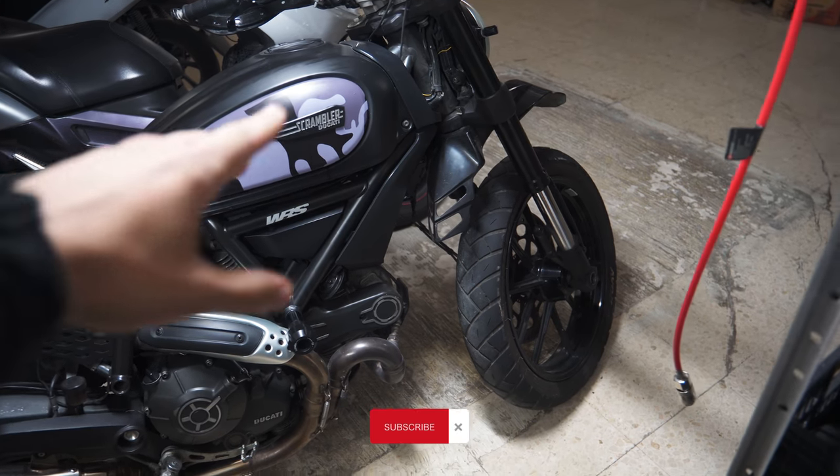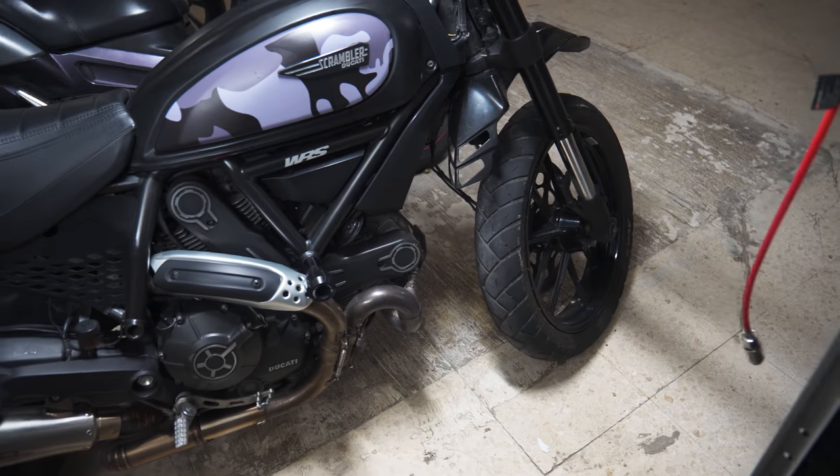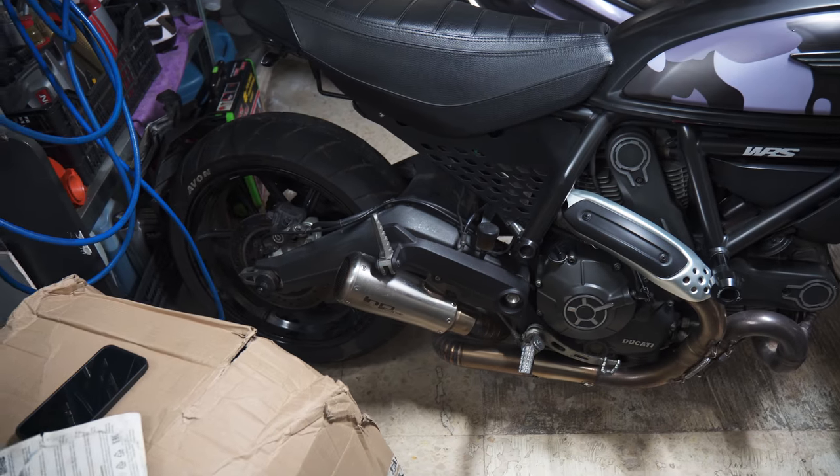With both brake pads replaced front and rear, I went for a short drive to break them in and remove all the rust I had on the rotors — they work perfectly fine. Obviously don't go all in on your braking when you've just replaced them, so for the first 100 kilometers take it a bit slowly until the pads break in. As you saw from the video, it's a pretty simple process — no fancy tools are needed and it's a pretty straightforward job. Both pads can be done in less than 30 minutes, front and rear. If you like these videos please subscribe to my channel and I'll see you in the next one.